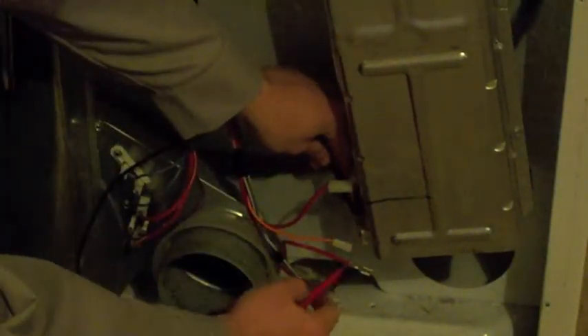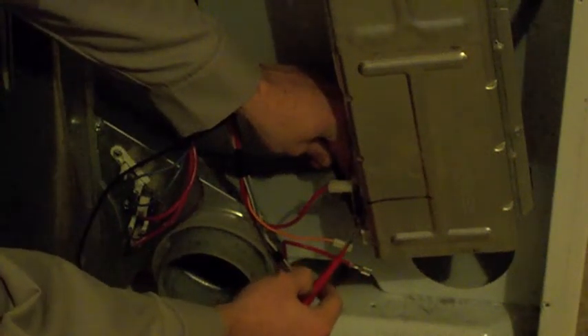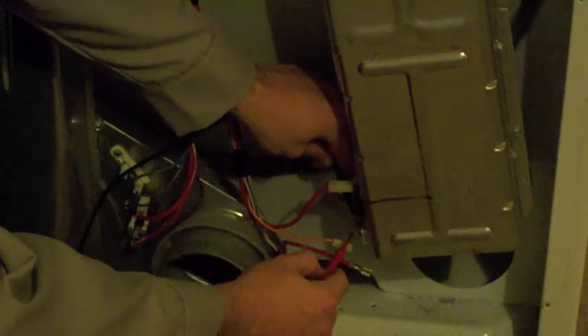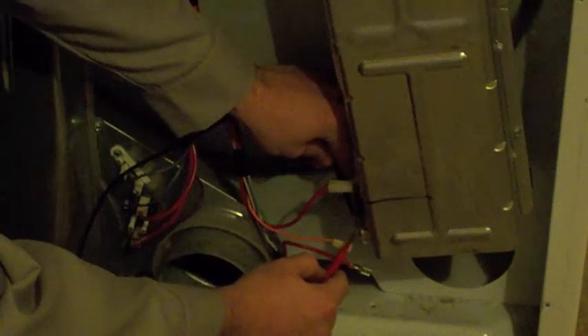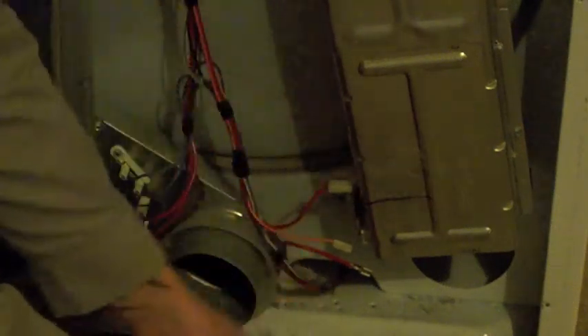To make this test, there are two terminals on the bottom of the element. Both these terminals, when live, should have 220 volts. We're making live voltage tests — you can hear my meter beeping. It just tells me that heater's good. All right, let's get started.